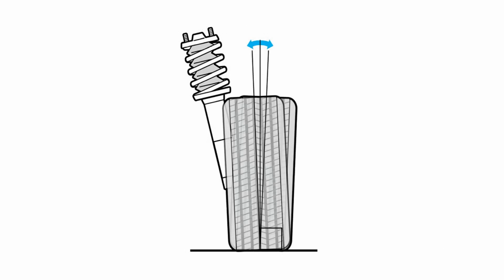Since anti-roll bars affect the roll stiffness of the car, your camber settings may change depending on how stiff or soft you set them. With stiff roll bars, you'll run a bit lower camber, and you might find your setup needing some more camber if you have to use softer roll bar settings. The same goes for natural frequency and downforce to a certain degree in regards to camber, but you'll see this effect more with the roll bars.